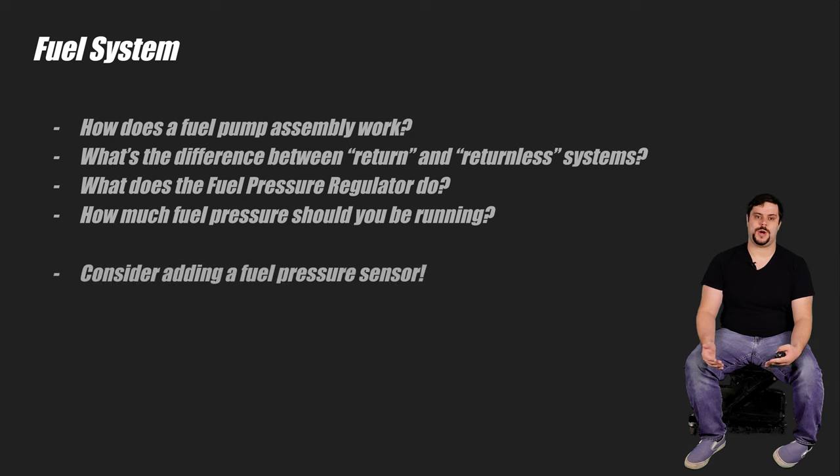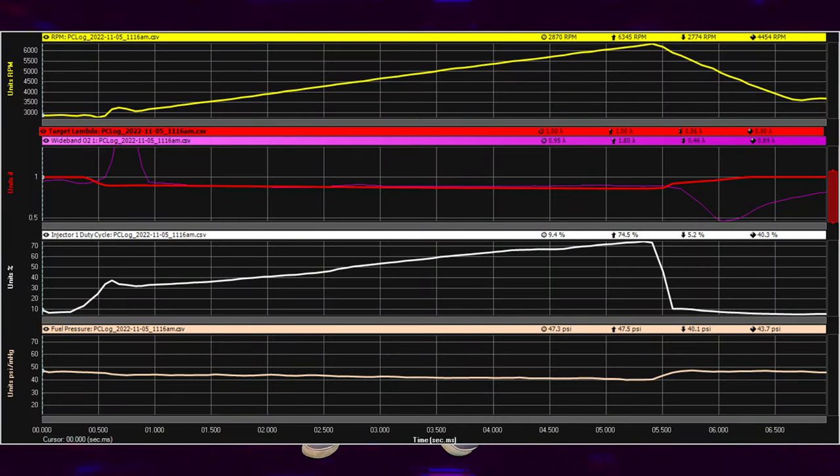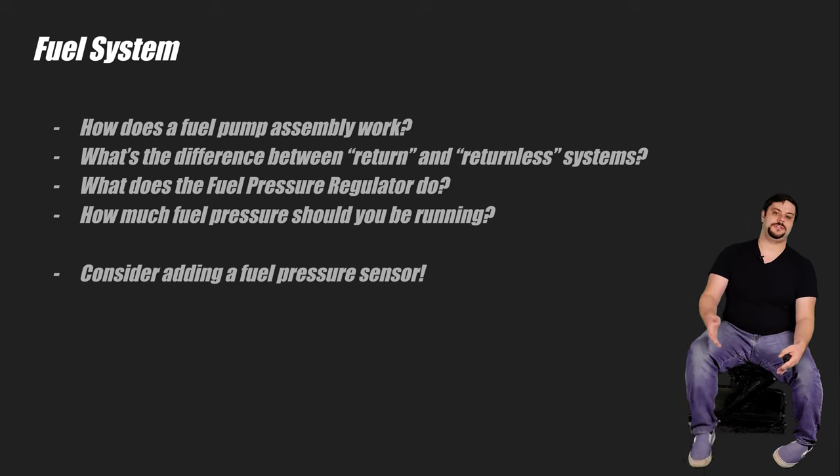Since this was a custom build, I opted to use an aftermarket fuel pressure regulator. The RX-8, on the other hand, has a returnless system — I plumbed this right up to the fuel rails, but I didn't change anything about the fuel system. Didn't even upgrade the pump — it's still the stock one that fed the rotary. Both cars are fitted with fuel pressure sensors wired to their standalone ECUs. If the fuel pressure drops below expected levels, the ECU cuts the electronic throttle and saves my behind from a potential lean condition. I knew the factory pump would work before ever building the RX-8 because I understand the relationship between fuel and horsepower — my big 6-liter V8 is being run by a pump designed to run a 1.3-liter rotary, and I have certifiable proof things are okay in the form of a data log straight from my ECU.